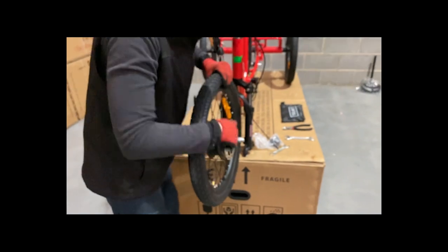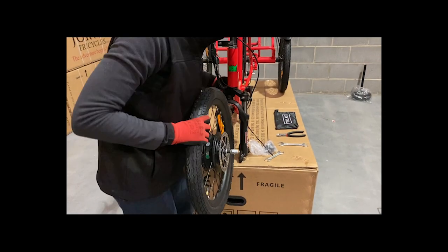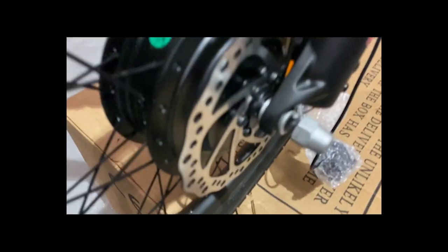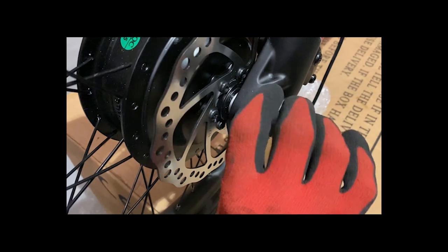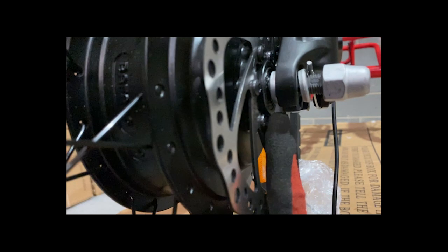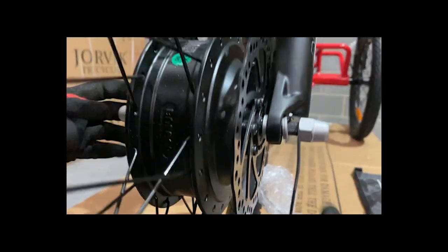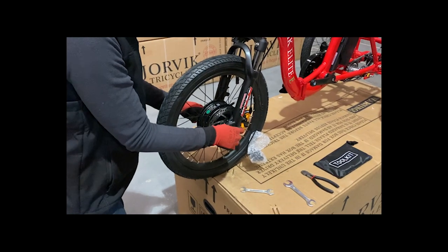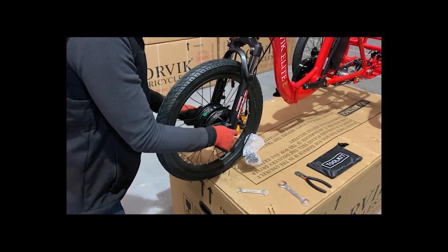You have a caliper on the right-hand side — if you're facing the bike, then the motor cable needs to be on the left. So with the rounded section at the top in orientation of where the forks are, lift them up with your left hand — you can always get somebody to hold the bike for you if you want. What we're going to do is we're just going to slip those over the top there. If you look underneath, you'll notice that little cutout is underneath here, and that's where we need it to be. So once it's on, make sure you don't get anything caught — move that cable out of the way. Hand tighten these until they're nice and firm.